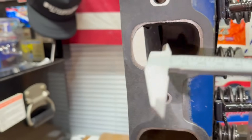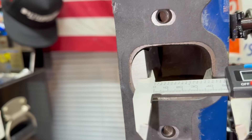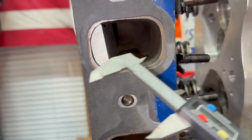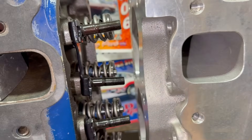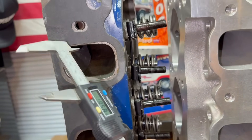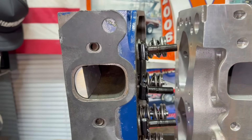Let's see what this measures. Again, not perfectly accurate while holding the camera, but it's reading about 1.86 — a little bit more than that. The bottom line is we're simulating that distance from here to here — about two inches. That's where you're going to pick up the torque, because they say this area is dead, and it probably is a little dead until you get the RPMs up past 4,500. So if you put the insert in here, you can pick up 30 foot-pounds of torque.